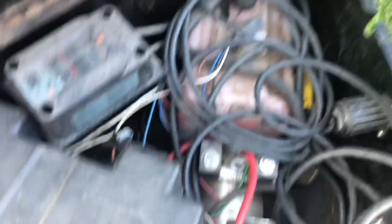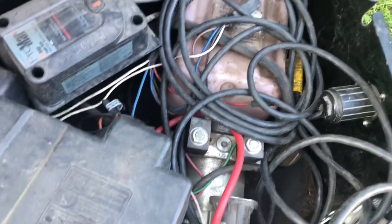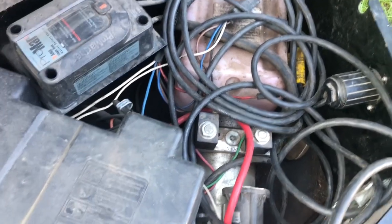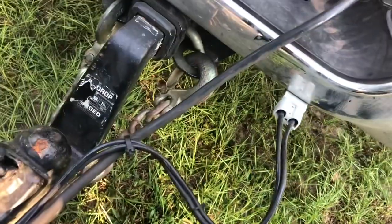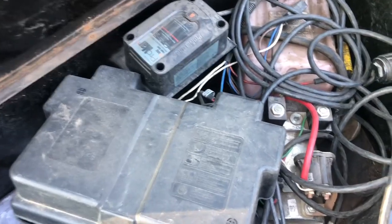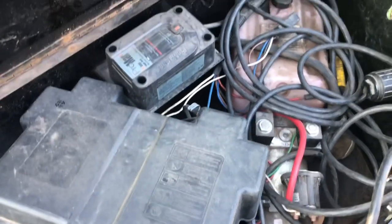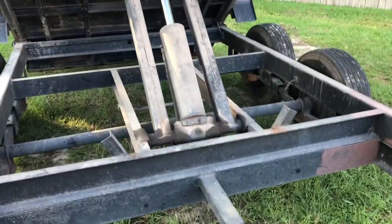The final thing to check out is the hydraulic unit. When you look in here you'll see the bottom of it is dry — that tells me it's in pretty good shape, no leaks and nothing blown all over the inside. Those hydraulic units — the pump and the reservoir — are available for three to five hundred dollars depending on quality. I've also got it set up with an additional lead going straight from my truck battery to each dump trailer, so it's automatically getting charged as I drive and is never without juice at the dump.